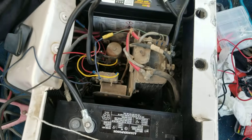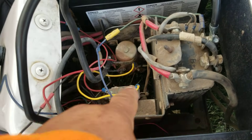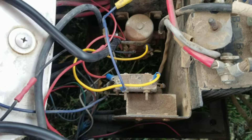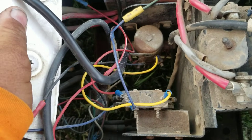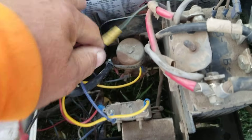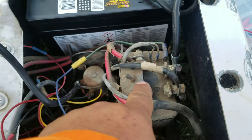The next thing is your solenoid. You've got your main power — the full pack voltage — going into one side of the solenoid. This big wire is the whole 48 volts positive side going into the side of your solenoid right here. The other side of the solenoid comes up and goes to this bolt right here.